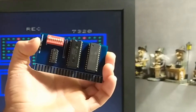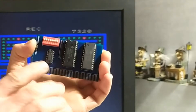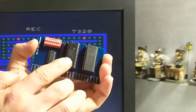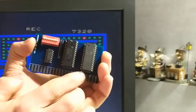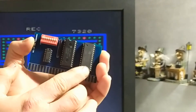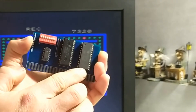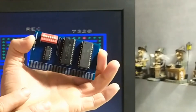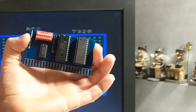That way we can play much more complicated games, or if you're into productivity on your VIC-20 you can be a lot more productive. One of the nice things is this 8 kilobyte SRAM chip works with the 32 kilobytes to give us the full 35 kilobytes, but also you can make it work pretty much like a cartridge, because it sits in the same memory location as a cartridge would on the VIC-20. Using switches one and two you can enable or disable this chip and also enable or disable writing to it.